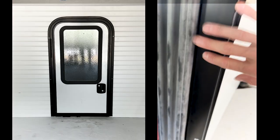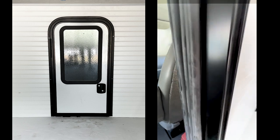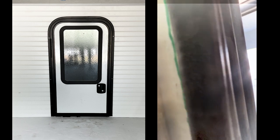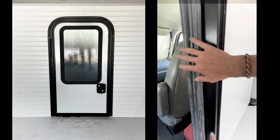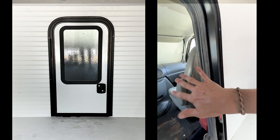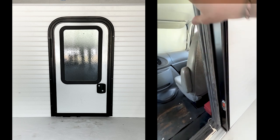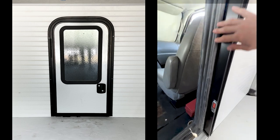Here's what it looks like — this side's already done. You can see the seal clips right onto the door on one side and onto the edge of the fiberglass panel on the other, creating a waterproof seal. Critically, because the cab and the box are two separate pieces, they move independently when you're driving. You can't have a rigid connection from cab to box — if you flex the truck it'll snap whatever wood or rigid material you try to build here. It has to be a flexible seal, which is exactly what the accordion boot provides.